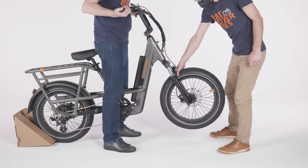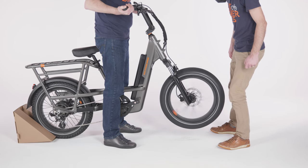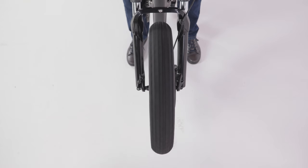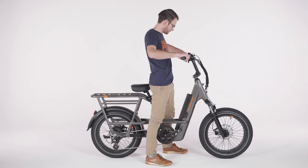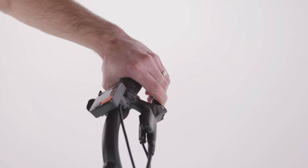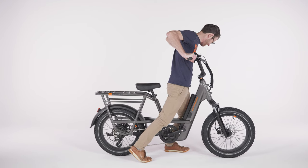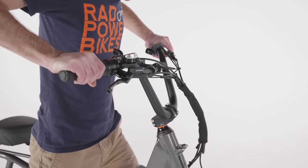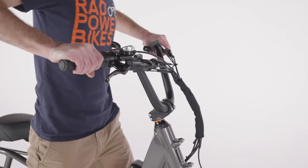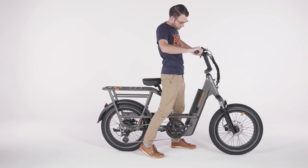Perform three tests on your front wheel. First, with your helper holding the front of the bike off the ground, spin the front wheel to ensure it has no wobble or looseness. Second, while straddling the bike with hands on the handlebars, squeeze the front brake lever with your left hand. Rock the bike forward and backward, and ensure the front brake is securely keeping the front wheel from turning and that there's no play or wiggle in the wheel, handlebars, or front forks.